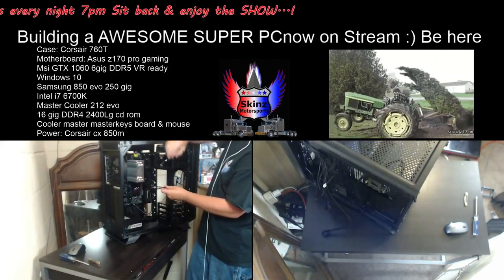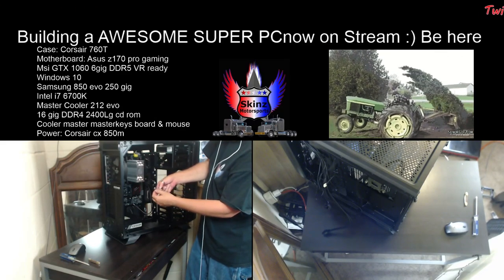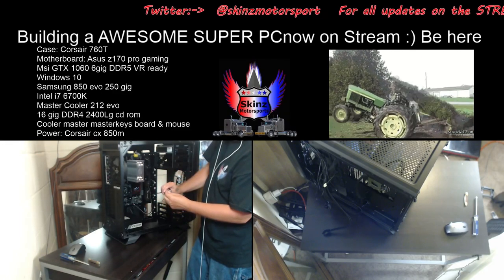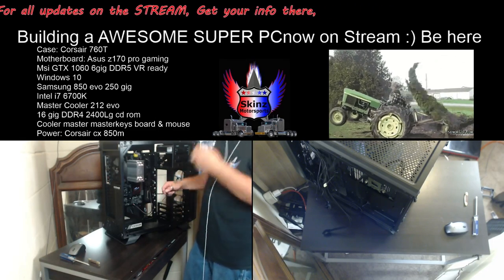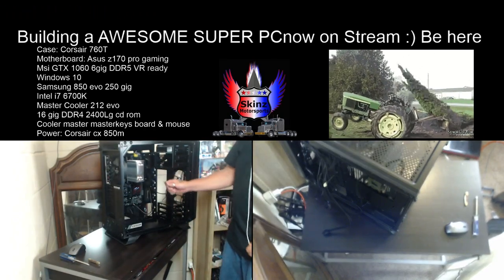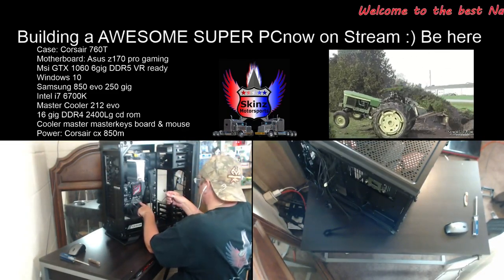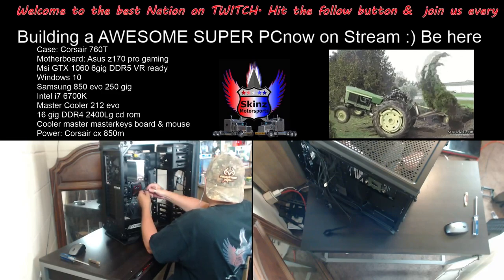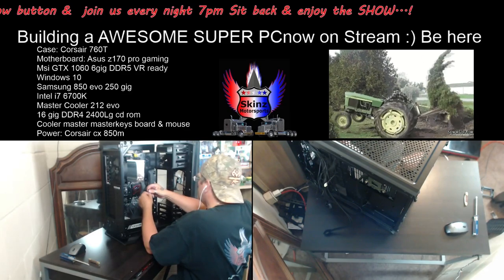Now these are our power button, our reset switch, our HDD LED, our power LED, and our other power LED. I didn't use these on my PC, but I did use the power switch and stuff. They're all going to be right here. Now, there's an adapter for this in the motherboard box.